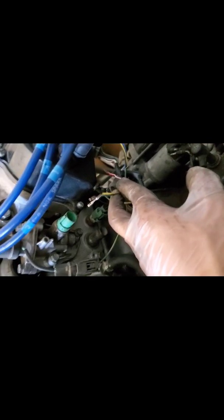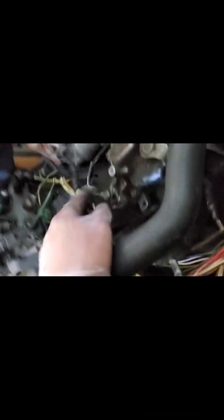This is the VTEC plug obviously — boom, there — I have the VTEC plug and everything. I just have to re-pin it and find out what these two wires are, pin it in. I'm not sure what that one is — I'll figure that out. So yeah, you would tape these up, freshen them up, clean them up, make it tight to the motor. I'm going to tape them up, get them all sweet looking, run it down through here so it looks super clean.